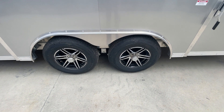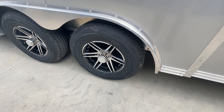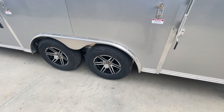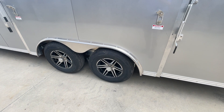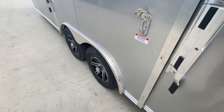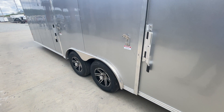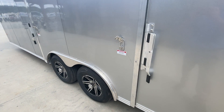This has the upgraded 5,200-pound axle. Notice it's got the aluminum wheel upgrade. It's going to have a 225/75 R15, 8-ply radial tire, load range D. One nice thing when you go to the heavier 5,200-pound axles, you're also getting the larger 12-inch drums — the same drum that's going to be on your 5K, 6K, and 7K axles. You've got plenty of braking and stopping power.